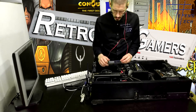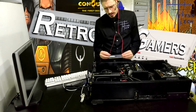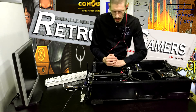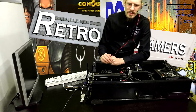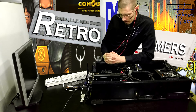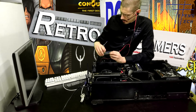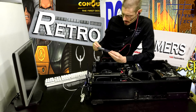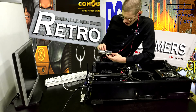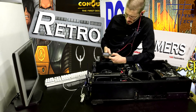The motherboard here is an LGA-775 and the processor is a Q8400. Back in the older times, these systems required low density RAM for it to be operational, and they weren't compatible with higher density RAM modules. Any RAM with chips of 512 or higher would not work — 256 was the limit back then.